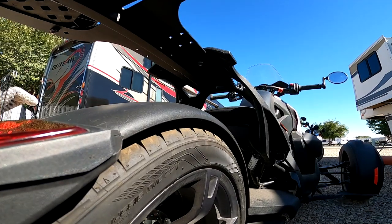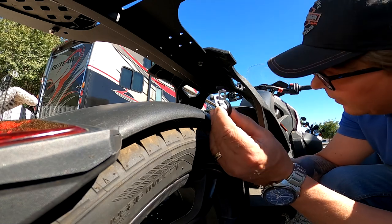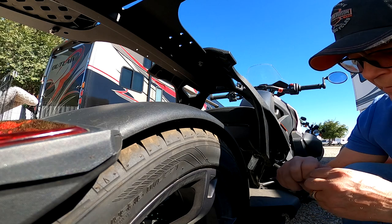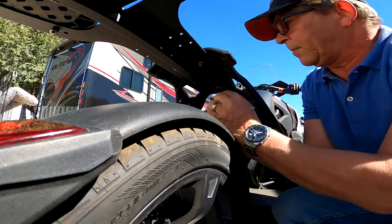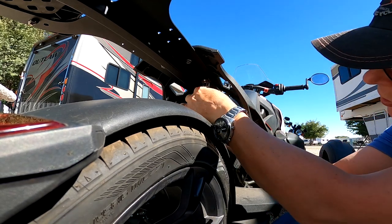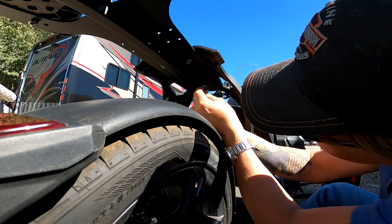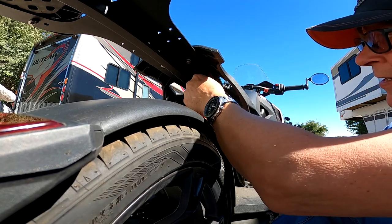Before mounting the last two of them, we have to have these cable brackets on. So we need those here bent over, and they might be able to bend a little bit more together, then they're easier to mount. As you have the spring load from this here, I found it easiest if you just use the extension from your socket and find where it goes, because you have to come over that spring load there. That turns out to be the easiest. Just find where they go in, and when you're there, start screwing it in.